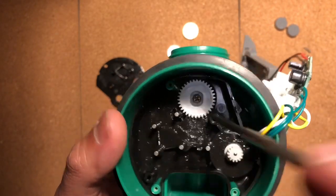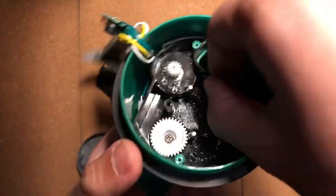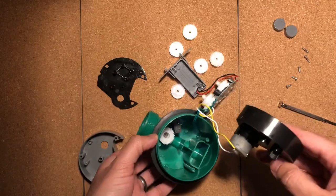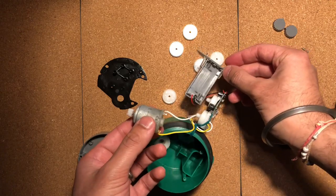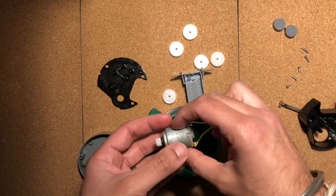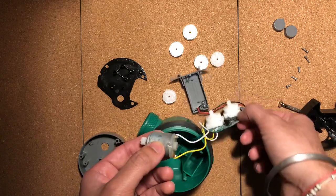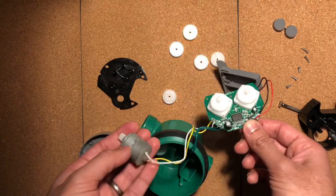It's worth noting there is grease here — no point cleaning that up because it's needed for the gearing. You don't want it to dry up because the plastic gears will wear out. The screw key you can leave in; there's no need to remove that unless you have problems with it or something stuck in there. There is nothing holding this in, and that exposes the motor and the limit switch for the valve. Simply push the motor out from the top. With fresh batteries fitted, I had no drive, and on initial disassembly I found quite a lot of water — the motor was dripping even after leaving it to dry for a few days. If there's power at the terminals but the motor's not turning, you have an issue with the motor. If there's no power at the terminals with the switches in the on position, there's potentially a wiring fault, a power fault, or a problem with the microchips on the board.